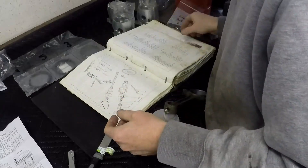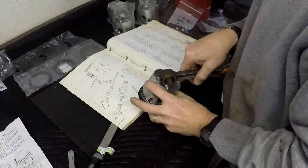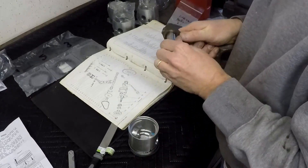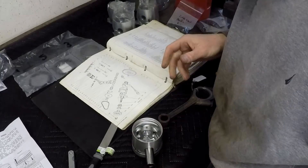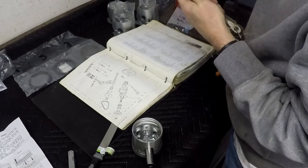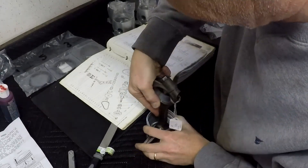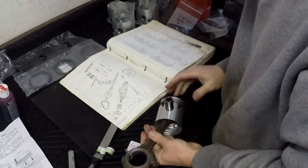The connecting rods are directional — they're not symmetrical. You can tell that the shaft of the rod from the big end doesn't come straight up unlike other designs, so it's important this goes in properly. It's not something that would be terminal if done wrong — you simply couldn't get the piston in as it would never line up with the crankshaft. I've got my Permatex assembly lube here, which I'll use throughout the engine build anywhere there are rotating parts.